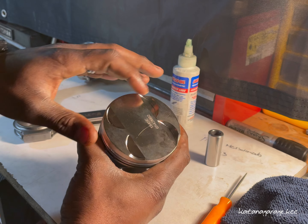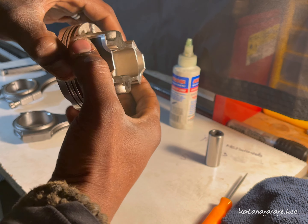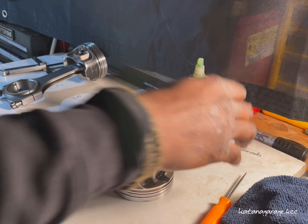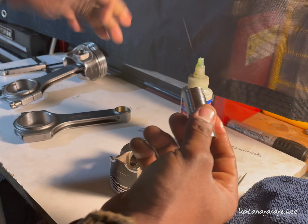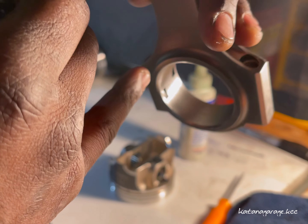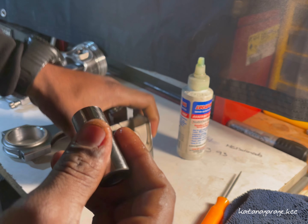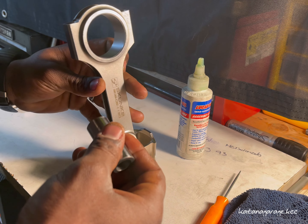Verify the location of your relief valves — it's important that they are properly oriented. Go ahead and grab your wrist pin and give it a nice dab of lube, swirl it around. Lubricating eliminates a dry startup on your initial first startup. Make sure the notches on the connecting rod are facing outwards towards the exhaust side. The big valve relief ports go to the intake, and the notches on the connecting rod face outwards.